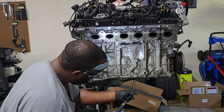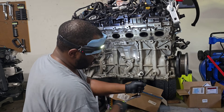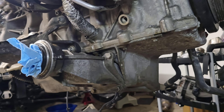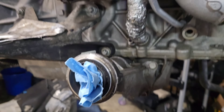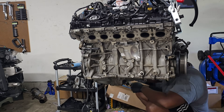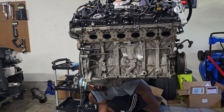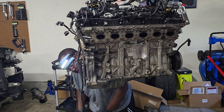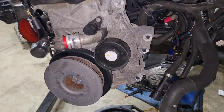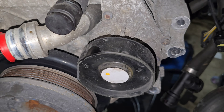Another thing I knew I'd need to swap was the oil pan. The reason is because the donor car was xDrive, and the main difference between xDrive and rear-wheel-drive engines is the oil pan. On xDrive cars, the pans have a hole in them for the half shaft to go through and the additional mounting point for the transfer case and axles. In my case, I don't need that because my car is rear-wheel drive. So we just removed all the screws holding my rear-wheel-drive oil pan onto my old engine and swapped that over to the new engine. Also here you can see why I had to replace my water pump — the donor engine had a damaged pulley on the pump, so that had to go as well.